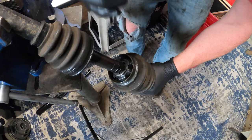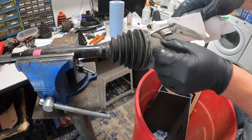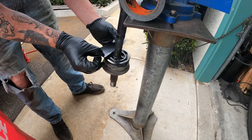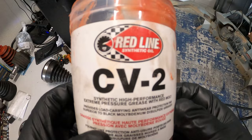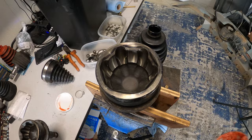There's very little information on YouTube about doing this with Tundra axles — plenty on Tacomas and 4Runners, and anything with a tripod inner joint you can find a video on, but these are different. I cut three axle shafts just to make two axles. It felt like I was committing a crime, but there is no other way to get the outer joint off. If anyone has another method, please let me know in the comments.